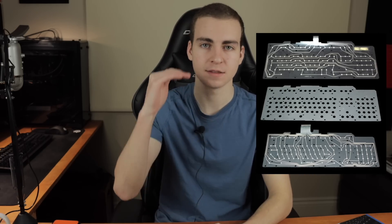Before I go into the details of both of these keyboards, I'm going to give you a very basic definition of the way that a standard keyboard works versus a mechanical keyboard. Keep in mind this is a generalization, just meant to give you a basic idea so you understand the advantages of a mechanical keyboard. With a traditional keyboard, the system typically used has a layer of key switches and three layers of plastic membrane below that. To signal a key press, you must connect the top layer of membrane with the bottom layer, where the middle layer is simply there to separate the two so they aren't already touching.